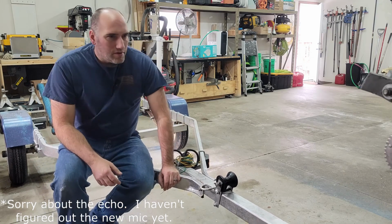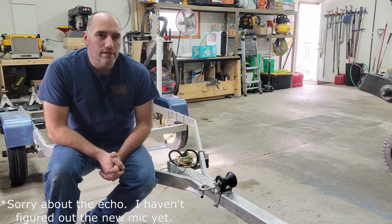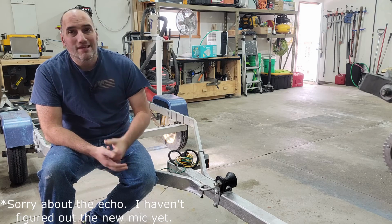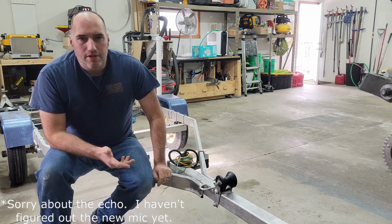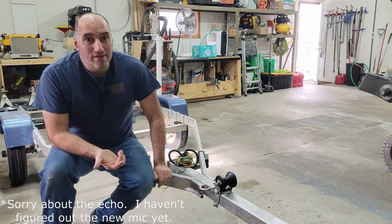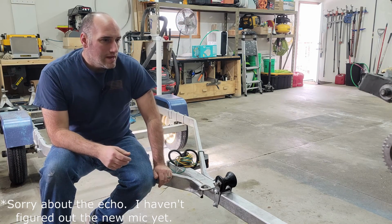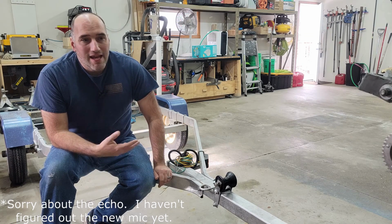So I'm going to take this further than probably most other people do. When people do boat trailers, they kind of scuff the paint up, give it a coat of paint, pack the bearings. I haven't seen much more extensive work than that. I'm going to rip this trailer down. Every nut and bolt's coming out of it. One way or another, if it breaks, okay. If it comes out, even better, because I know how to go get a replacement bolt. I plan on doing coatings on all the bolts to prevent them all from rusting.